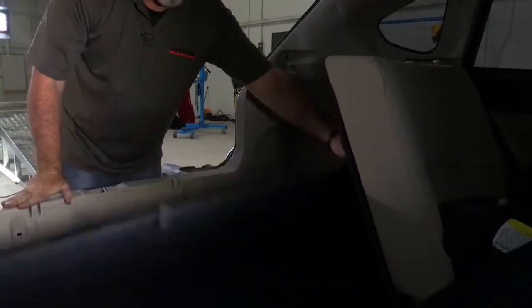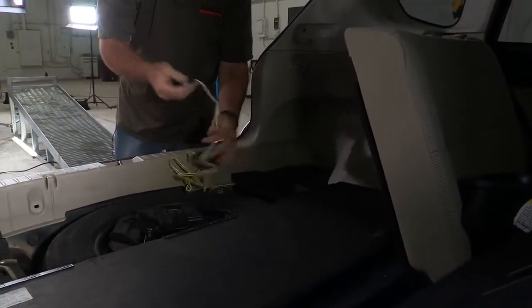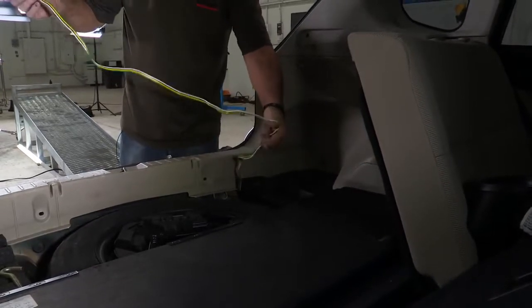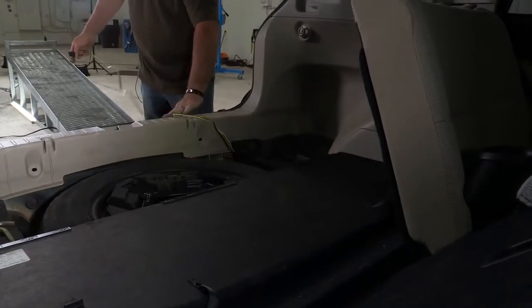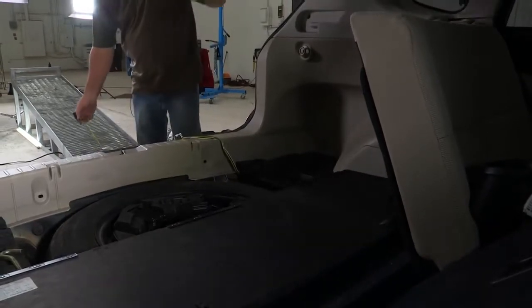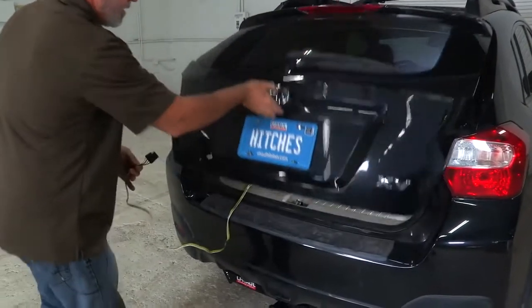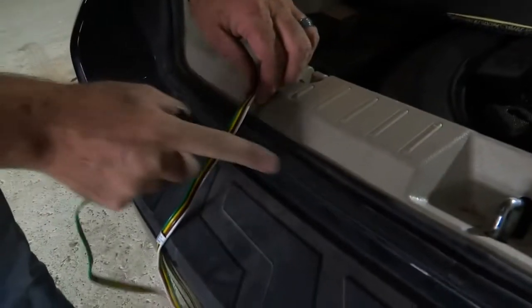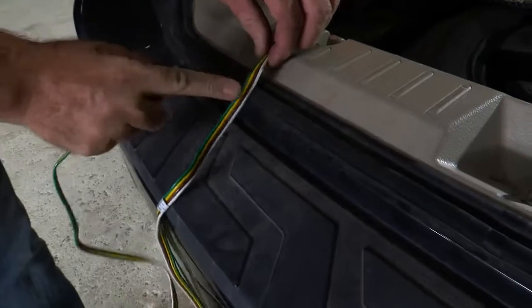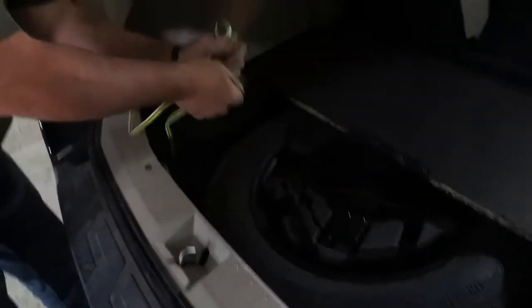I'll just show you how to operate it when you're ready to tow. Just unfold your floor there, take your stowed four-flat out — you've got about three feet of wiring here. Basically when you're ready to use it, you'll just pull it out, lay it over the weatherstrip and go ahead and shut the door over that. Now I'll go ahead and open the door again and show you that there is no damage to the wiring when you shut the door. This is where it went over the weatherstrip and you can see there's a lot of give to it — it'll just compress right into it. And then when you're not using the wiring harness, you can go ahead and fold it back up and stow it next to your spare tire.